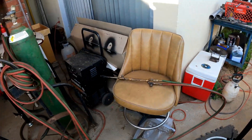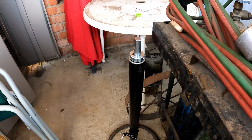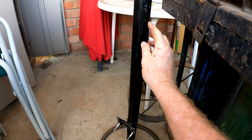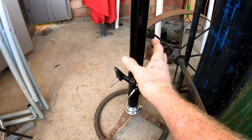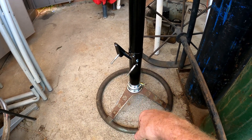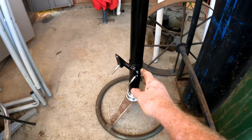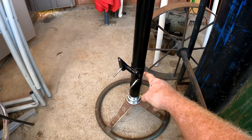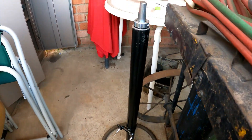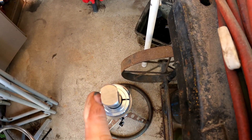The column is only inch and a half, and we both agreed to keep it a little more traditional, so I bought this column from Speedway. It's inch and three-quarters — a hot rod style, super simple, not big and bulky like a tilt column. It'll look more traditional and does have a quick release top on it. I put a dummy wheel on it for mock-up and bought some clamp-on mounts to go with it — pretty cheap, got two of them.